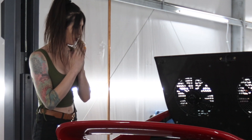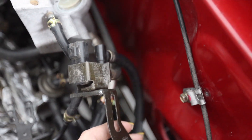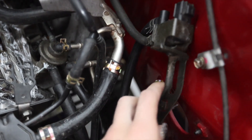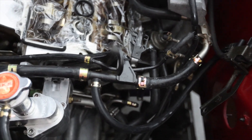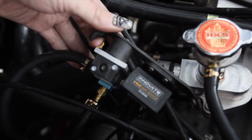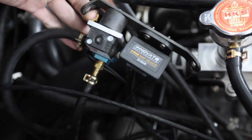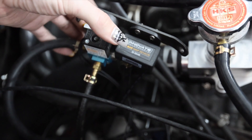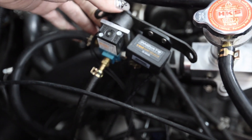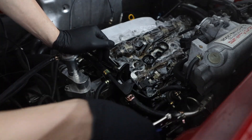That is going to look so good. This guy right here is my factory MAP sensor — I'm not going to need that anymore. There's a spaghetti web of hoses for the MAP sensor, and then I got the Innovative MAP sensor right here which is a double redundancy. I think I can get rid of both of these and just send the signal to the new one, that way my boost gauge still works. So most of this can go away because I'm not going to have AFM anymore — it uses speed density.